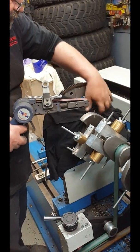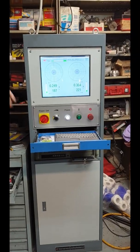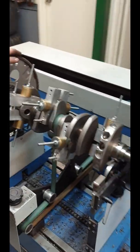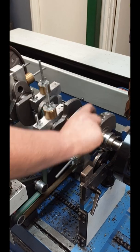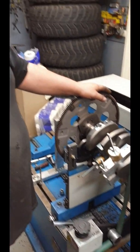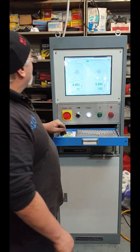0.8. It's time to take the weight off here now. 0.2 of a gram. This is — I'm actually impressed with the Eagle crank. It's a bit messy but I don't know if I put that on the lathe and machined this down if I could get away with doing fewer holes. But again, they're a very heavy crank with very lightweight pistons, light rods, light pieces — and that's not bad. It's pretty good. I'm pretty impressed, I'll actually use their product again.